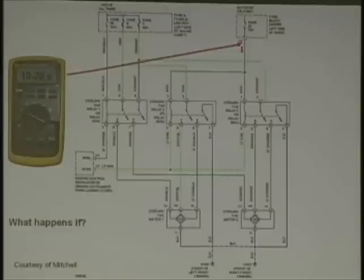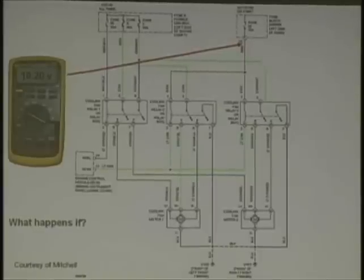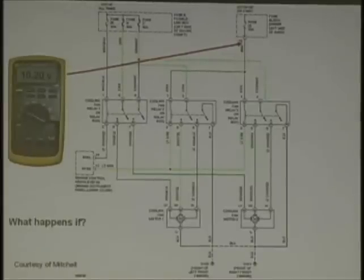Remember, we're on the main power feed here. There should be charging. The car's running, the PCM's calling for fans, and you've got a voltage drop. Now, where could that voltage drop be? On the feed side of that coil. And the coil has a lot of resistance, so it couldn't be a ground side problem. Very good. The coil has a lot of resistance, that way it doesn't pull high amperage. That's the low amp side, and you'll see that when we get to the coil.